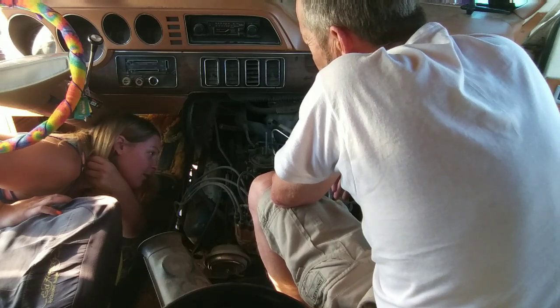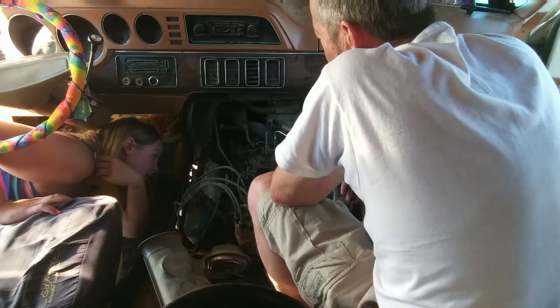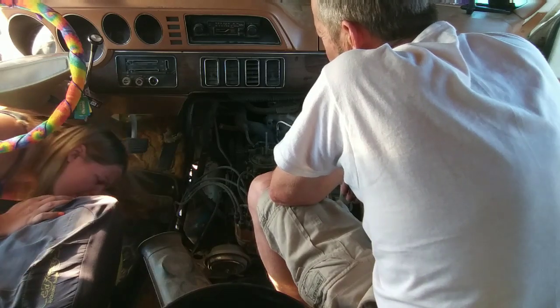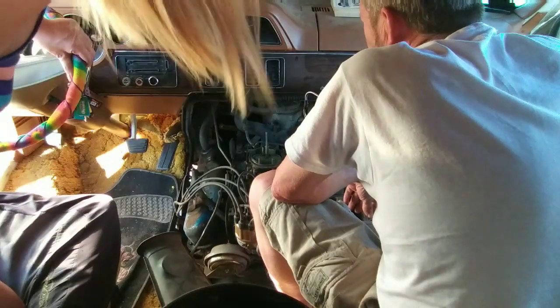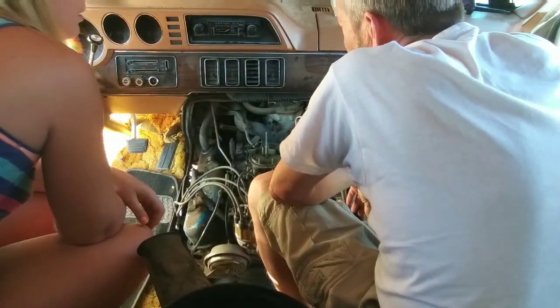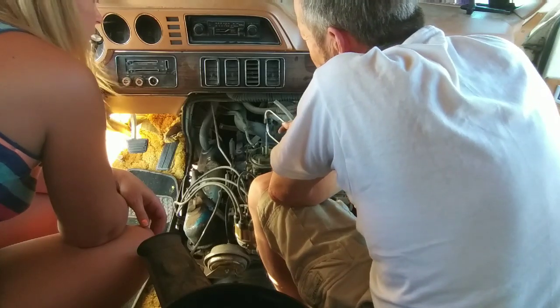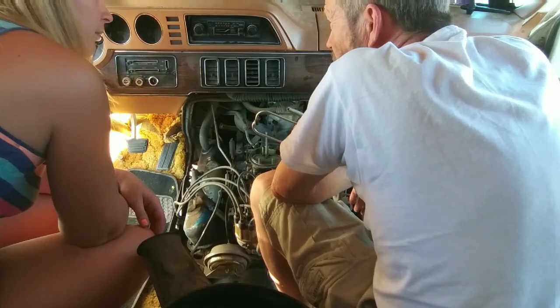I'm not afraid of rebuilding this thing. I've done a lot of these, and I know how to read the instructions. It's already been rebuilt once, though. I know, that ought to be easy this time. But can't we just buy the base plate gasket? Yeah, we could, but if we got the carb off, I'd sure like to pull the air horn off of it and check the float level, just in case that guy screwed it up.